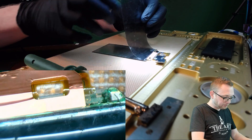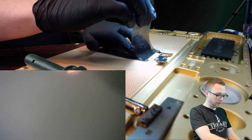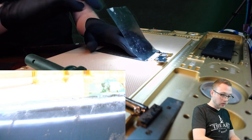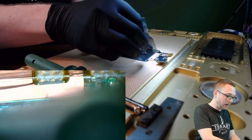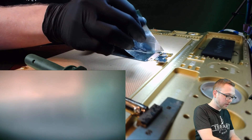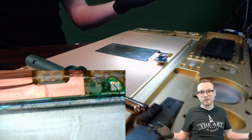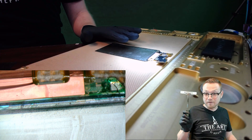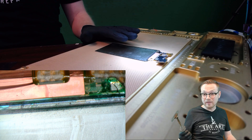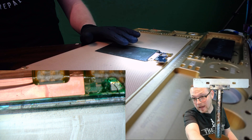So I'm going to show you in the microscope here — we can see that I'm stopped right about there. What I'm going to do at this point is stick my hand under the polarizer, carefully hold the display down. We don't have a lot of room for this thing to be adhesed anymore, so there's not really anything holding it down. We can carefully just peel it off — and look at that. It was literally that simple. This is a very simple technique with a very cheap tool. They last forever; I have had this for years. This is my go-to.